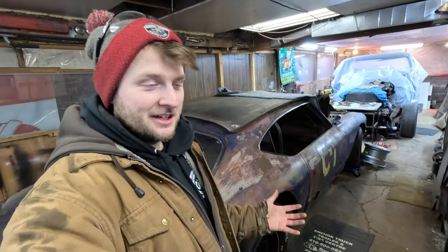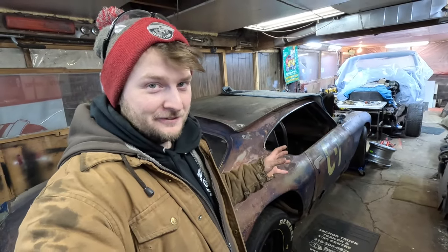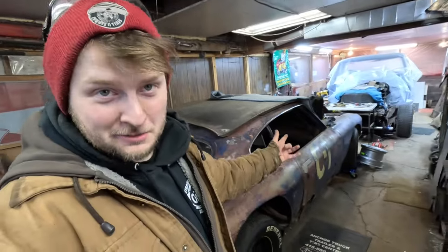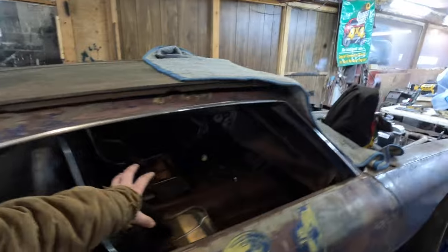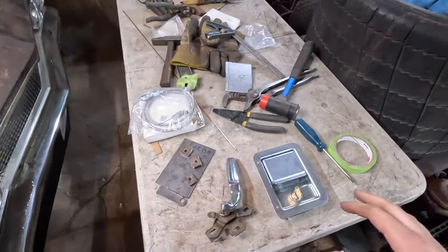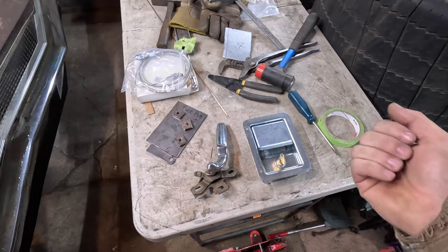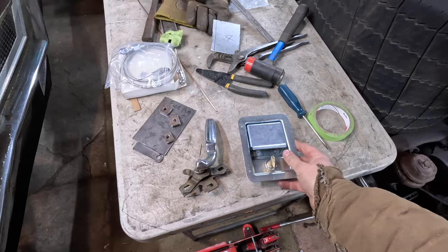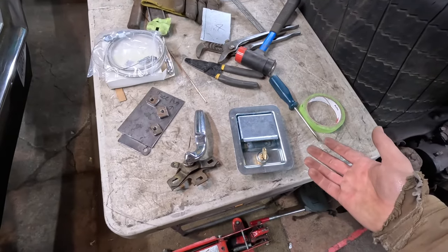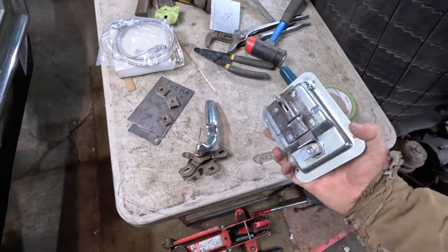The first thing we need to figure out is door handles. In the last door video, you guys were probably confused about how you're going to actually open those doors from the inside and outside — so we're going to figure that out. I've actually already done the driver's side, which is super weird because usually I do it first with you guys. For the outside handle, we're going to be hiding it in the rear wheel well. This is the handle I got — I had to modify it to make it lock. The other one on the other side was discontinued, so I just made it from what I could buy at my supplier, and it worked out pretty much the exact same way.